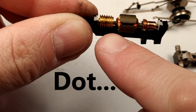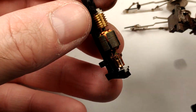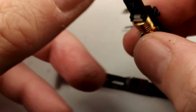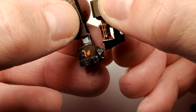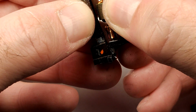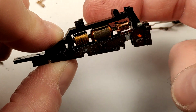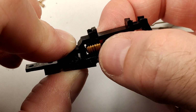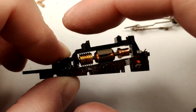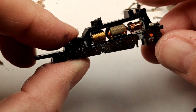Okay, I'll put a dot of grease on the worm gear at a later date once I've got it all together. So I might not show you that, but you will need to do that. So, to stop this falling out, and try not to touch this degreased piece here, I'm going to pinch that like that. I'm going to grab our chassis. And just like we slotted it out earlier, we're going to try and slide it back in. I'm holding the forward edge of it against the chassis because then we need to see if this rotates freely. Which it does. Lovely. And it's got just a tiny bit of chatter. If it's pinching it too tight or clamping it down, you want to rectify that issue right here before carrying on. Otherwise you're just wasting your time.